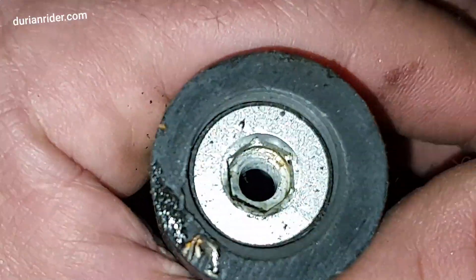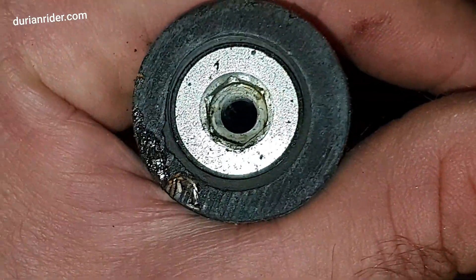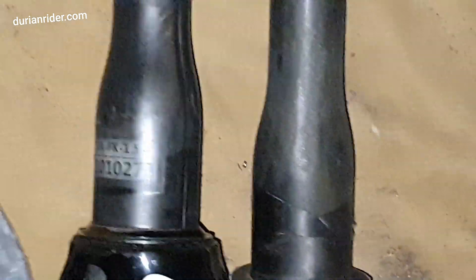You only see it on carbon fiber but not in alloy. My assumption is it goes with a loose headset — loose headset causes this ring barking. As you can see, this is safe to ride because it's just a millimeter. But you can see over time that's just going to etch in. And if you're a heavy guy hitting drop-offs on your mountain bike, it's going to snap and cause a failure. But we can see how much material is on these Easton forks — they're probably the strongest fork out there in terms of thickness.